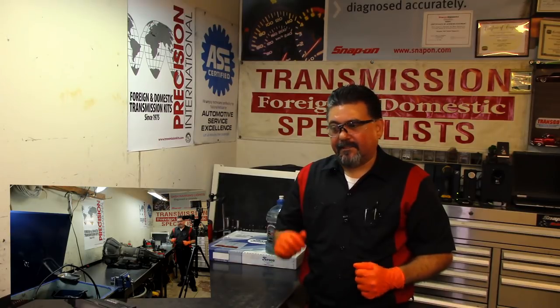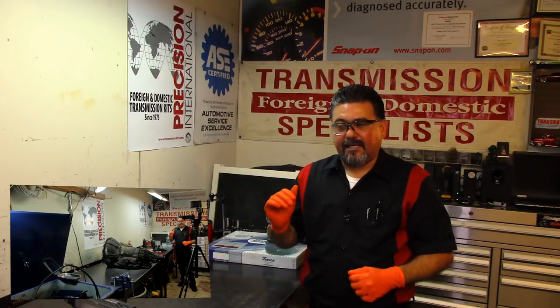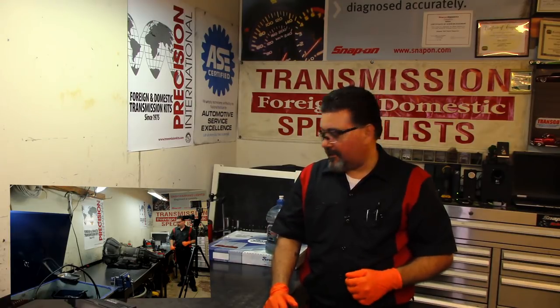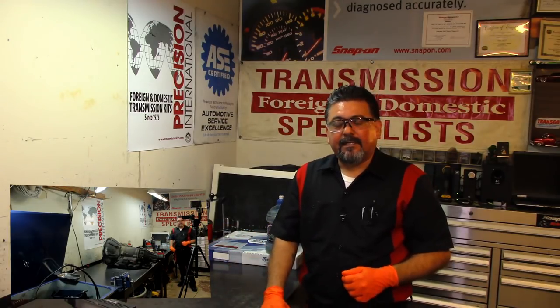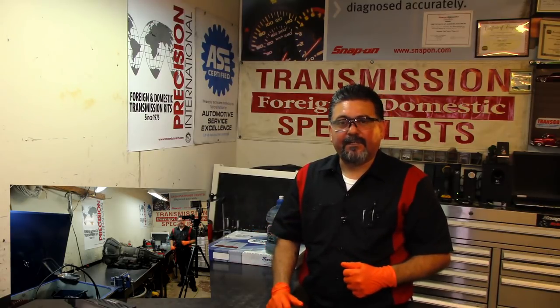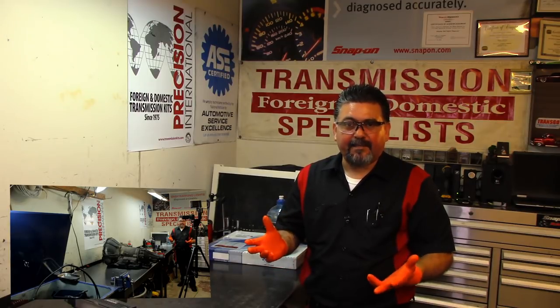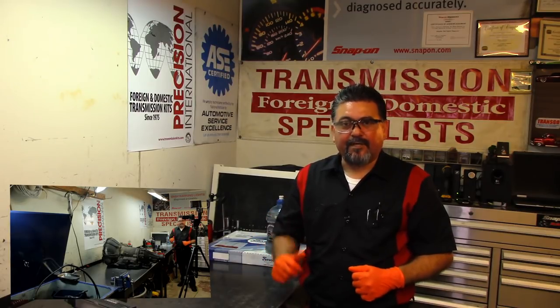So this is gonna be a special edition Jetaway 315. These are not very popular on the road. Parts are available. We got the parts here. The band, we're gonna see what shape it is, but we're gonna have it relined because those bands, you cannot get them anymore. So you have to get them relined.